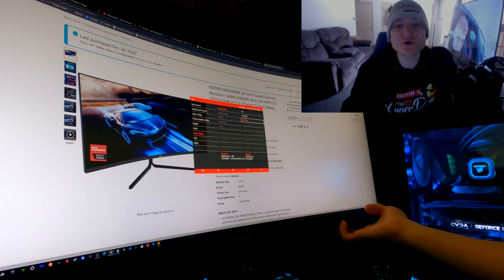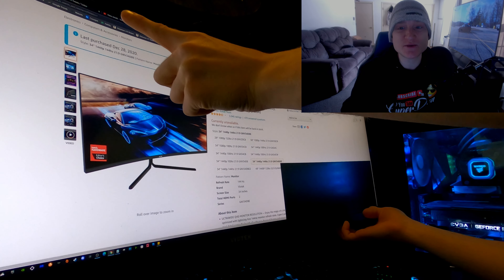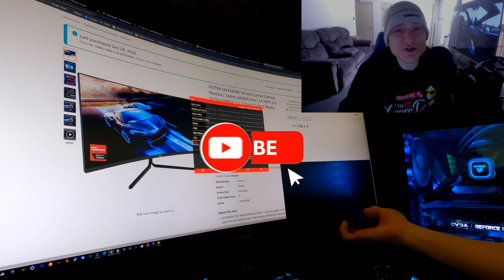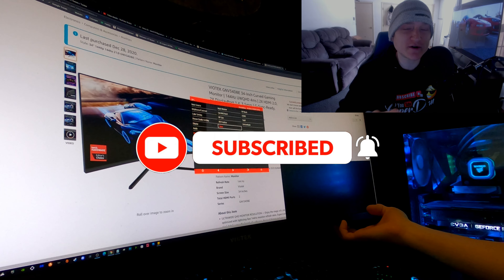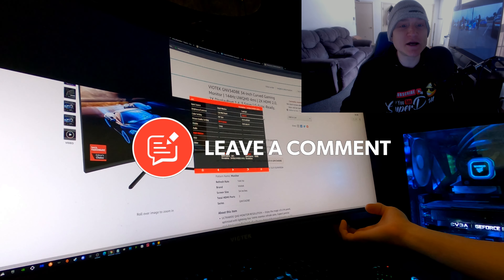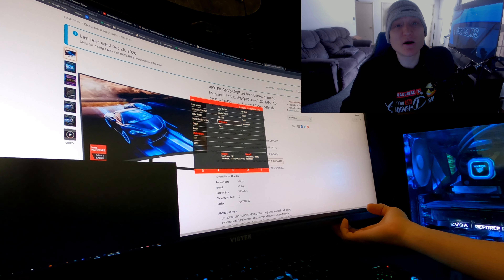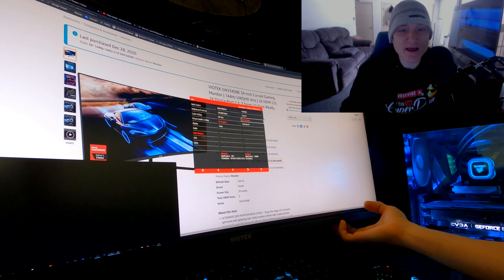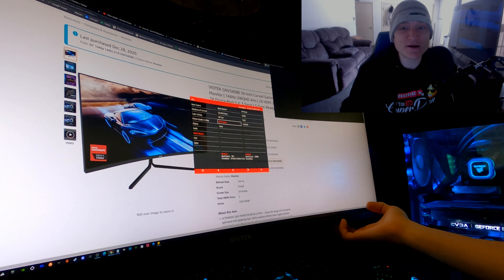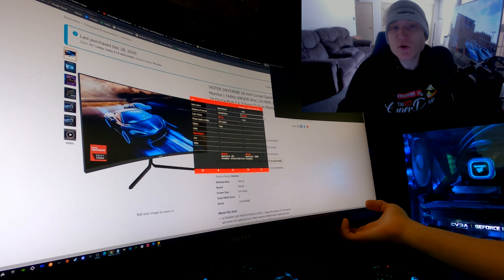The third and final downside is the PIP mode, or picture-in-picture mode, where you can have two inputs on one screen. It lacks a lot of adjustability. There are other monitors where you can adjust the transparency to actually see the main input, as well as adjust the resolution for the input overlaid on your main display. On this monitor, you can only add another input, adjust its location, and choose from small, medium, or large — which are pretty much the exact same size on screen. It would be nice if you could adjust that resolution manually or through NVIDIA's control panel, but you cannot.